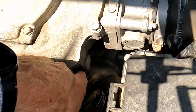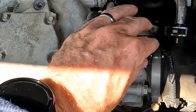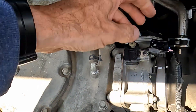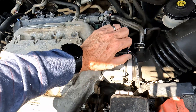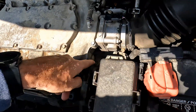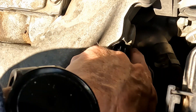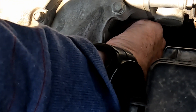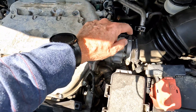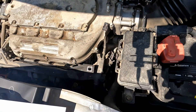The first step is to disconnect the harness from the sensor. It's hard to see down there, so I'll show you on this particular sensor. Basically, at the top you push this tab and then pull the connector off. This isn't the right sensor — just showing you the technique. Down here on the actual sensor, just follow this wire, push on the clip on the top, pull it off — it comes off pretty easily.